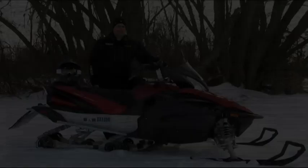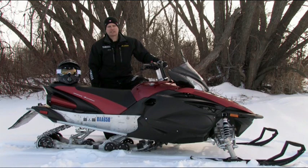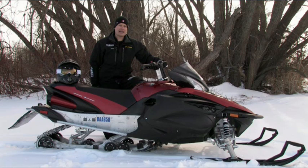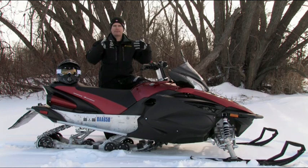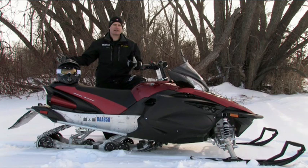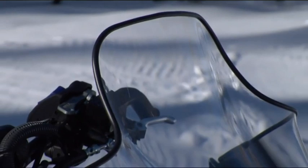Another part of ergonomics that we changed has to do with the rider envelope and wind protection. A lot of effort went into improving wind protection in this machine. It's easy to make the windshield bigger and protect the rider more, but the bigger it is the more drag you create, and that can negatively affect top speed. So we did a lot of computer modeling and some wind tunnel testing to find out where the envelope is around the rider. It's easy to block the wind coming from the front, but there's a Bernoulli principle that will actually bring a swirling wind effect in behind you. A lot of effort was made to make sure the rider was protected from wind coming from the front, but also to extend that air bubble behind the rider to prevent the swirling effect. When you look at the windshield design, the outer edges are really controlling a lot of the airflow.